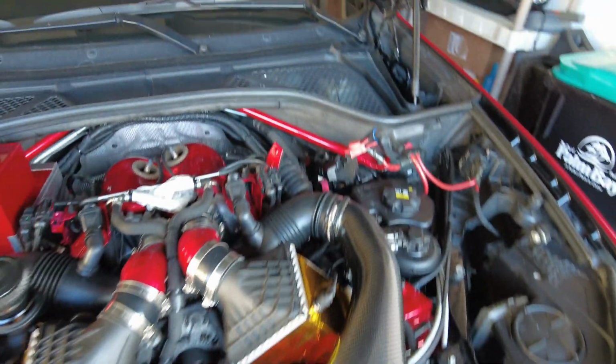But for the over boosting of the engine, let me tell you about that. What's happening is the turbos are over boosting. As of now, with my completely fully built car, I mean transmission, engine, extreme cooling mods and everything like that, the stage 2 is only meant for 22 pounds of boost, and I think it's a 23 or 24 emergency cap. So if it goes over that, the car is going to think something's wrong with it, and it's going to throw itself into a drivetrain malfunction.